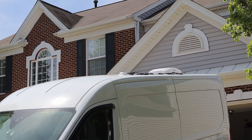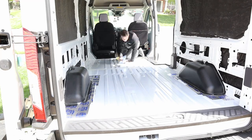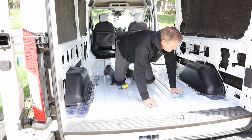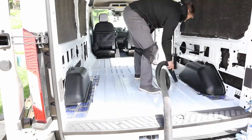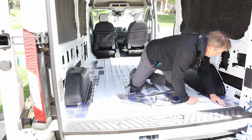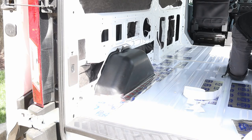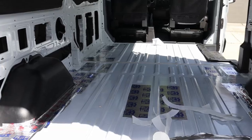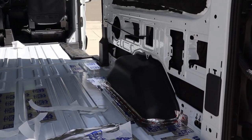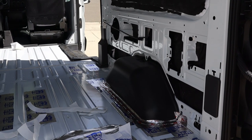Just hope they all work — otherwise I'm going to have to slice one of those panels off the roof. Alright, let's get to cleaning up this floor so we can put some fat mat down in a couple places, and then we can start cutting our template for the poly-iso and glue it down. Here we go. Got both wheel wells fully taped around the bottom, so now I think we're ready to start marking our template to put down the poly-iso. Let's get to it.